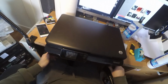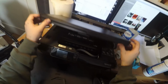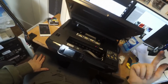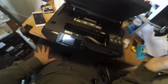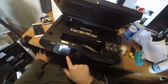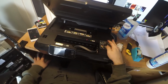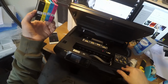And the printer is fixed, but there's a very important thing to say. The printhead that you have inserted into the printer has been flushed, or it's a new printhead. So inside it will have cleaning solution or shipping fluid that you can find in new printheads. So when you power on the printer, you will have to do a few cleaning cycles, generally 2 or 3 cleaning cycles. This means that you will have to use new cartridges.